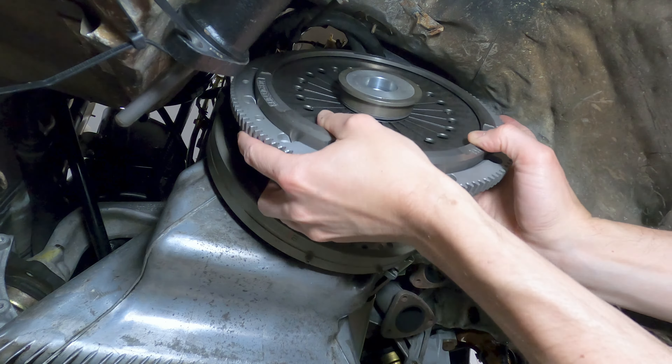While reinstalling the exhaust system, I replaced one of the exhaust hangers for $31, a rubber mount for $20, and the exhaust sealing ring for $26. By this time summer was approaching, so I took the opportunity to repair the car's air conditioning and convert the system to R134A refrigerant. Since the system had been compromised and inoperable for the length of my ownership, I thought it best to go ahead and replace the AC compressor with a rebuilt Nippon Denso unit, as well as a new receiver dryer and all the O-rings throughout the engine compartment, parts for which came to $645. I picked up a Santec retrofit kit that included the R134A valve adapters and replacement valve cores for $20. The HVAC control panel needed a little help as well, where the AC switch had previously broken, so I performed a refurbishment on the panel using some parts from a pre-owned panel I bought for $91. After adding 27 ounces of Freon and recharging the system for $38, total cost for this repair came to $794.32.